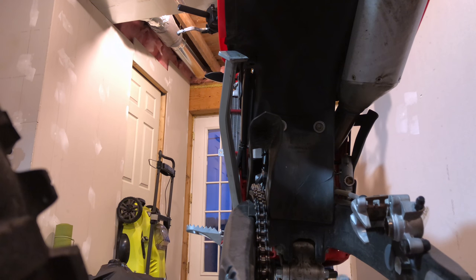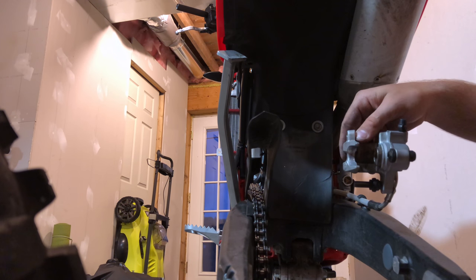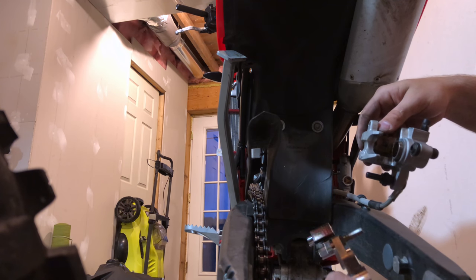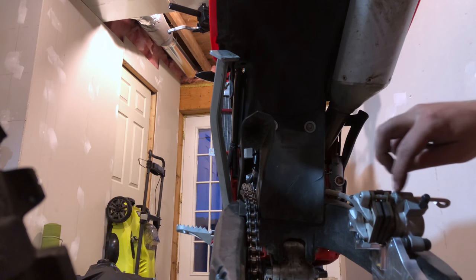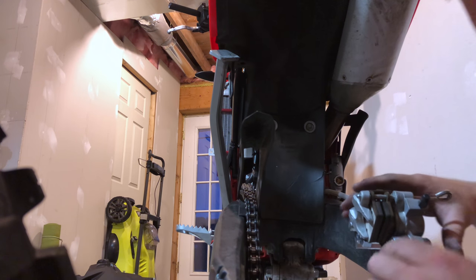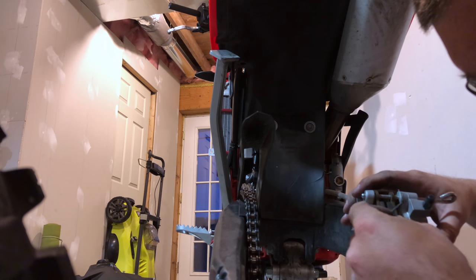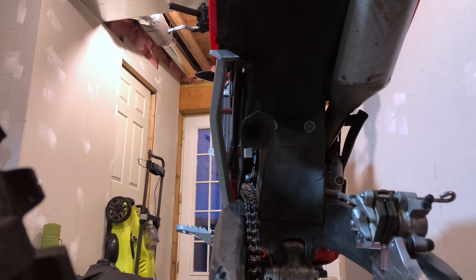We place a little bit of grease on this carrier here and we've slid the boot on the front slider right there. Now we can slide this in. We've pushed the brake pads back in, put the slider back in there, pushed that up a little bit against the pin so we can get that through with no problems. Make sure you're torquing that down.